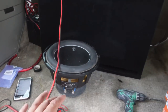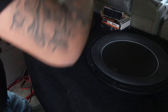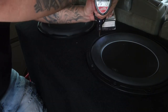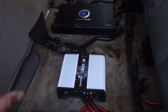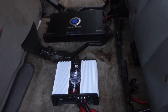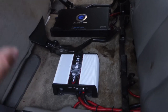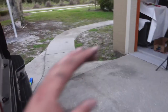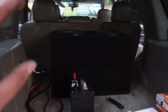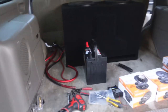We're just going to turn it down some and adjust it so his sub knob is practically wide open but the gain barely up — just enough so that thing is beating. Even if he wants to really get heavy on his bass, it's still safe to play and he's not getting the full power out of those amps. Amps are in, wired up, everything's ready to rock and roll. I even tried to tell my boy we can build a quick little panel to make the amps look a little bit better, and he's like 'I don't care, just wire them up, screw them down, we're good.'